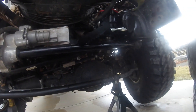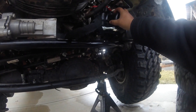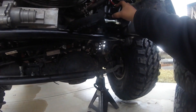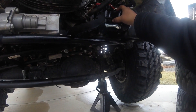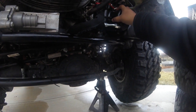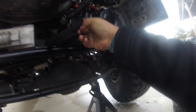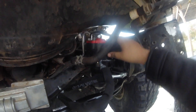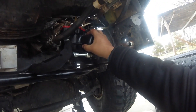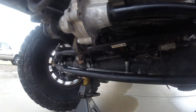Let's talk about this steering setup. My new gearbox is from a company called Redhead Steering — it's a one-on-one match for this 2019 Power Wagon. The steering box is listed for the 2500/3500 from 2012 to 2016, so that's the one you want to buy. I went with Redhead because you can purchase them pre-ported with two extra ports. Your stock factory ports are still up top, and there are two additional ports which will run hydraulic lines to your hydraulic assist.